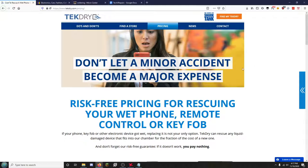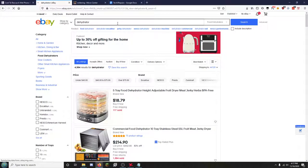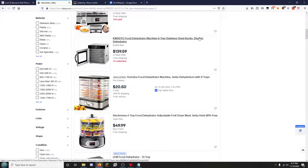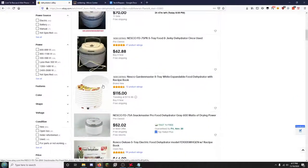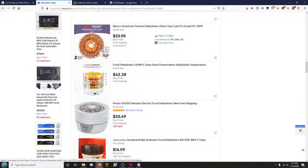Let's talk about the tools you do need to do electronic repair. A dehydrator is a smart way to go, but you don't want one with metal shelves unless you have plastic things to put the phone or circuit board on top of. You want one with plastic trays, not steel racks. You throw one tray in the middle rack and let it sit for about half an hour at 50% power — that sucks a lot of the liquid off the device.